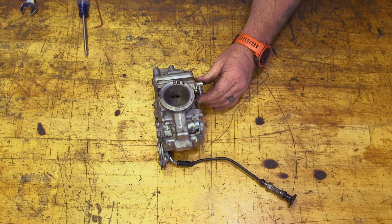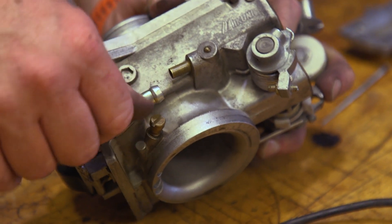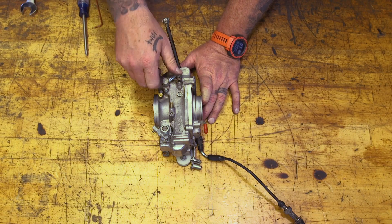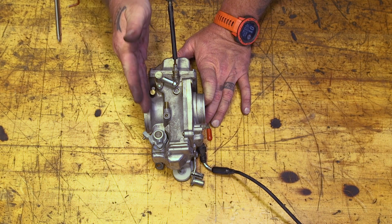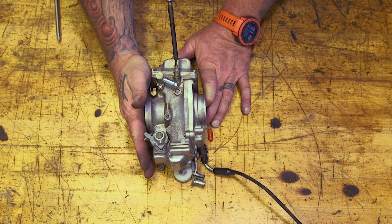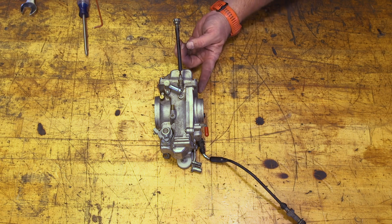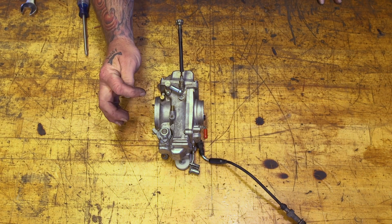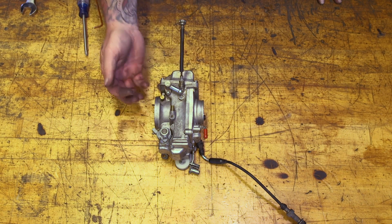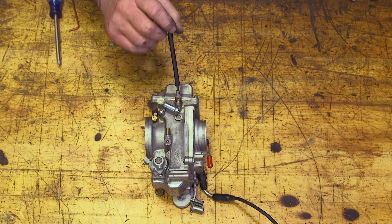Let's take a look from the outside of the carburetor. This is our fuel inlet — this is where the line from the gas tank hooks up. On a CV these are plastic a lot of the times; the Mikuni has a nice metal one and it swivels, so if you need to move your fuel line depending on how you're routing it, it's easy to do. This is your air-fuel mixture screw, and the main difference from a CV is it's on the air cleaner side, not the manifold side. On a CV the air-fuel screw controls the fuel; on this idle circuit it actually controls the air. It both ends up affecting the same thing — your air-fuel mixture at low speed — but this does it via air instead of fuel.